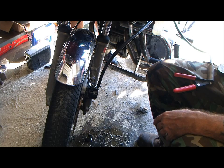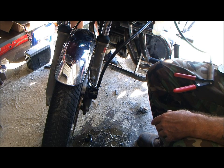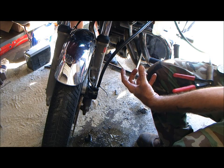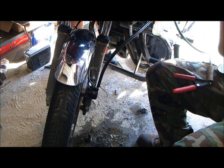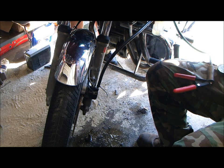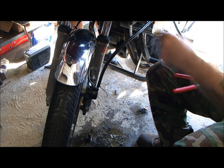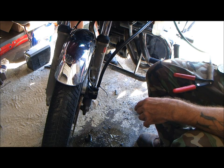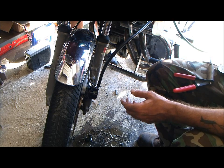Yeah, listen. All I did is take a C-clamp and a board and I popped it until that back came loose, and then when I was filling your reservoir with the brake parts cleaner, to get the 2 passages, to get the chunks out, I shot down into the holes. I made white shit come out. White, creamy, like when you mix oil and water.